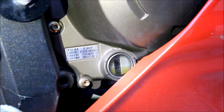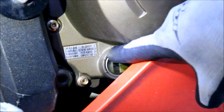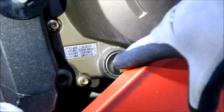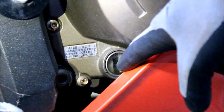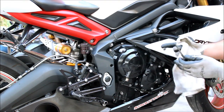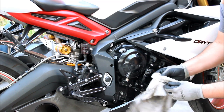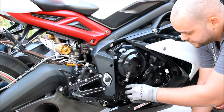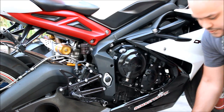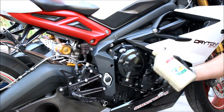If you can see the little marks on the side of the sight glass, right over here and over here, this is marking your minimum and maximum. You want the oil level to be right in the middle when the bike is level with the floor. For most sport bikes it's going to be straight up and down, so it's nice to have a rear stand to hold it straight up, or a friend to hold it if you don't have a rear stand. So you want to take the drain plug out, wipe it clean, and then go ahead and reinsert it. Now we're going to start adding oil. The oil of choice here is Castrol Power RS Racing 4T 10W-40, full synthetic.